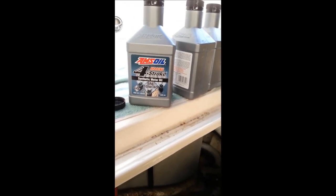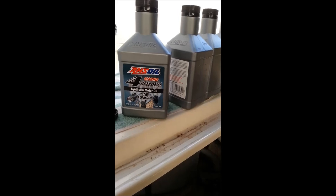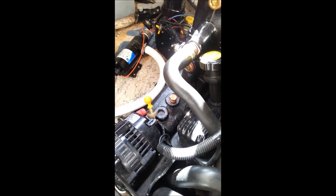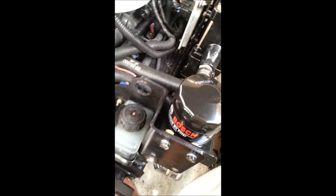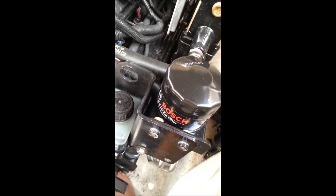Okay, we got all the oil out — it came out nice. I was surprised at how little there actually is in this oil pan. It took four quarts almost exactly to refill this engine. You want to make sure you don't overfill these 350s because they knock like mad. These lifters do not like having too much oil in the oil pan.